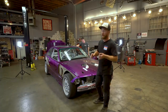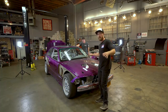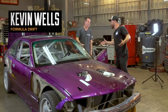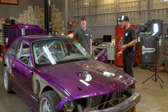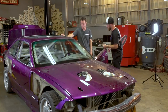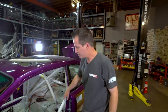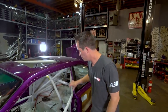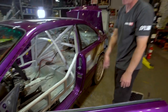The car is near completion — one thing we have to do is safety. We have to get to track inspection and make sure the car is ready to get out on track. Our guest Kevin from Formula Drift is the man you have to go through for any tech inspection — the one who will tell you if you can or cannot be on track. One of the first things he looks at is tube size — Formula D requires an inch and a half, 0.095. The door bars are good on this car, at a good height to protect the driver.